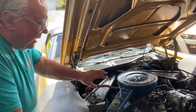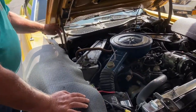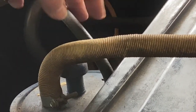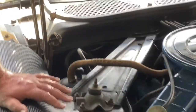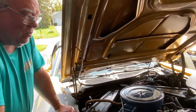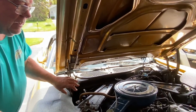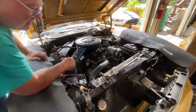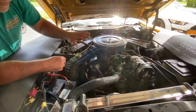Before I pull off the air cleaner housing, I want to point out a few things. Way in the back, we have a blue canister with a corrugated paper and foil tube and vapor line running to it. I'm not going to get into a whole lot of detail about this fuel evaporative system because I have a video already covering that — I'll put the link in the description. What I am going to be doing is in a few minutes taking off the air filter housing so we can see other things about the vacuum control system.